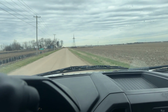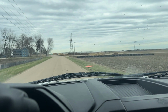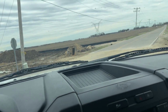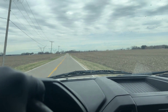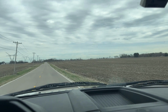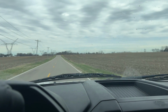We did driveline services on this vehicle, and I feel so bad for this guy. He's got 200K on here just about, but the trans had this fine slurry of aluminum in it. I didn't see any brass. I didn't see any actual hard steel chunks in there, not like that. But it was a fine slurry of aluminum, which, you know, is to be expected to an extent. That's why you do pan drops and fluid services throughout the life of the trans. Get that stuff out of there because it does affect the valves and all that stuff.